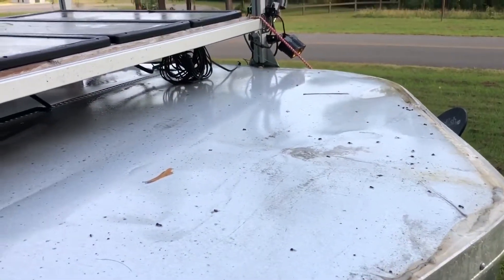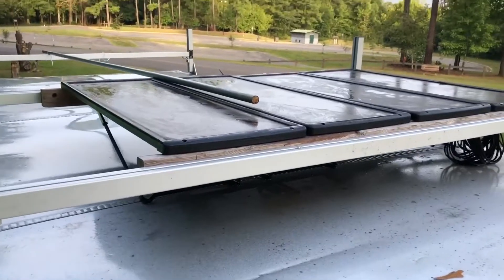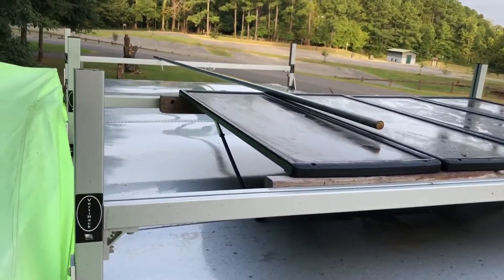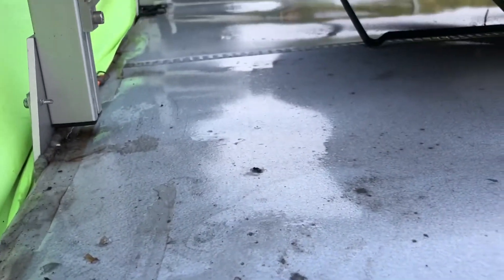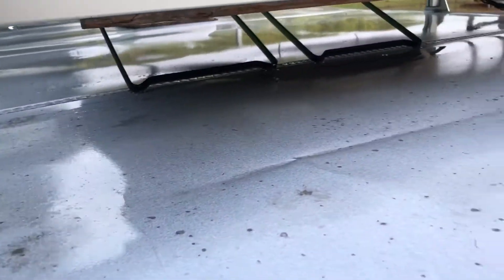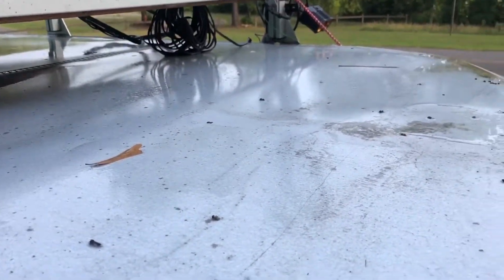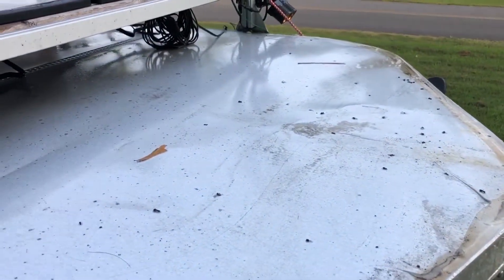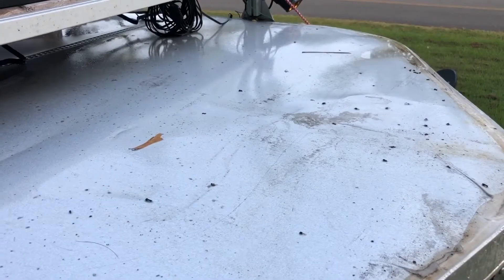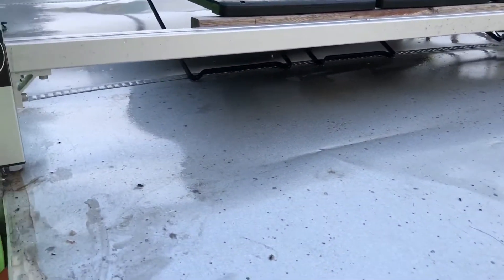Patrick here bringing you a rooftop shot of our trailer and there's our solar panels. Here's what the roof looks like — dirty, not too bad though. It's grungy and I rinsed it off. I had tarps up here to give it some shade and cleaned it up with some Crazy Seal cleaner, then put on some mastic and a rubber roof membrane. More to come.